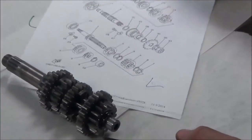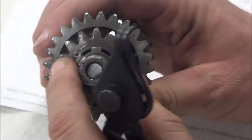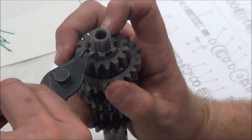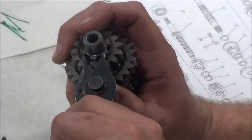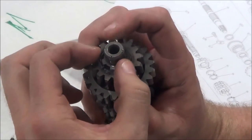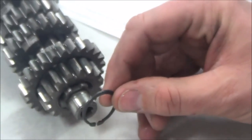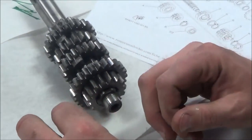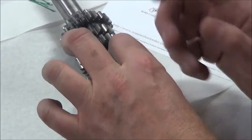I'm going to get back in here and look, and do we see our eyelets? Yeah. Now, since I picked this up off the table, don't I have to be really careful of orientation? Yeah. Okay, if I wouldn't have my finger there, would that have gone flying? Oh, Jesus. Yeah, right? Now we're going to learn something about snap rings, too: they have a rounded edge and a flat edge due to how they're machined. We've talked about a piece of metal being stamped. That's going to be pretty important on the assembly. That's the whole thing that is a fail on a lot of transmission installations, even from the factory. There have been factory recalls simply because this has been put on the wrong way. We're going to come back to that.